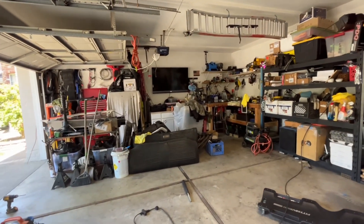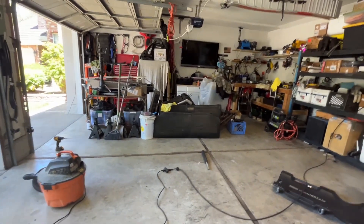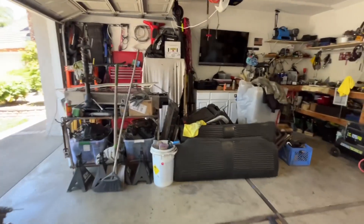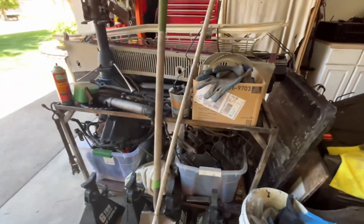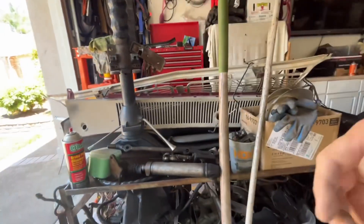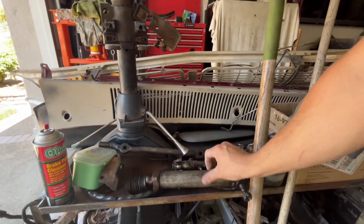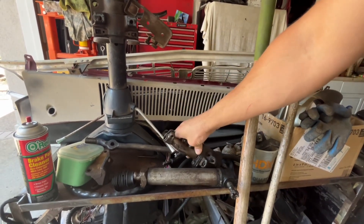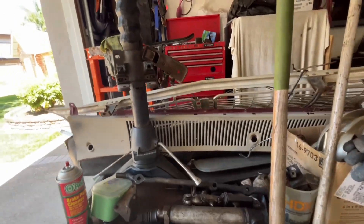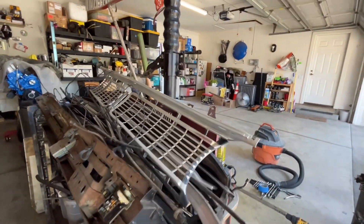I need to figure out the motor and trans combo, get brake lines taken care of, decide on the engine once it's on the ground. Got to seal the fuel tank — still deciding if I want a new fuel tank or keep the original and do a fuel tank restoration pour. All the parts in the buckets will start coming out. For the power steering rack and pinion, I need to get new seals — Bendix seals — and then the power steering will be good. Still need tie rods, and there's all the chrome and dash to sort. It's in parts but it's coming together.